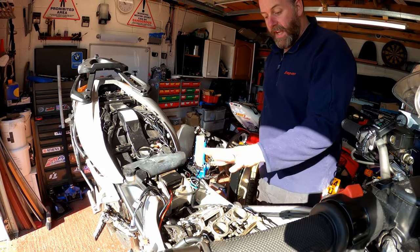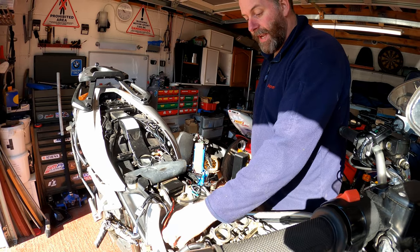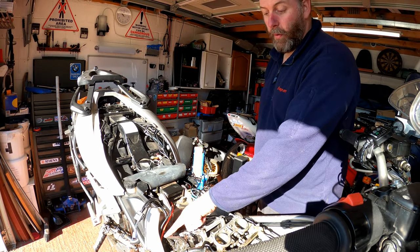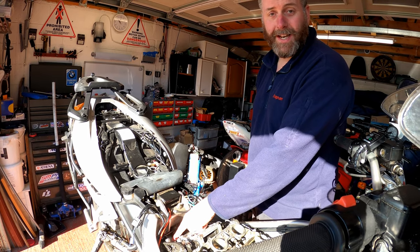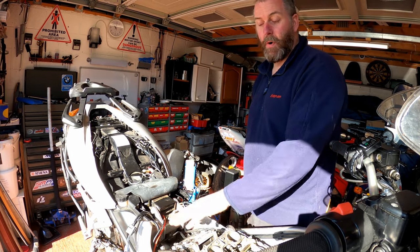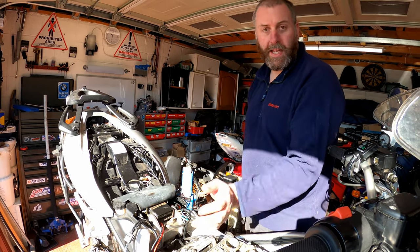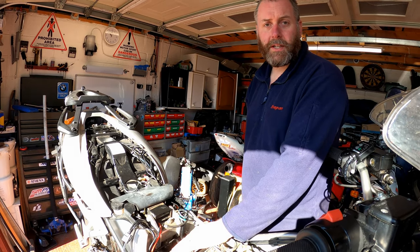And there we are. That is the camshaft fully reinstalled. The chain feels tight here, however, the tension still isn't on. All that tension there is held between the two camshafts. So what we need to do next is just release the tension on the cam chain tensioner, because there will be a need to rotate the camshafts as we go through the gauging process.